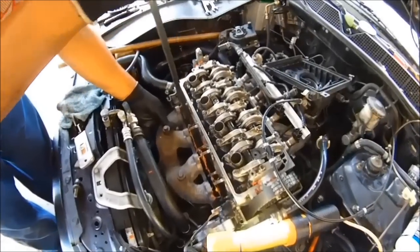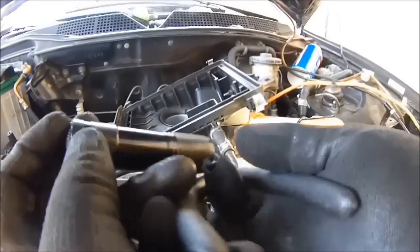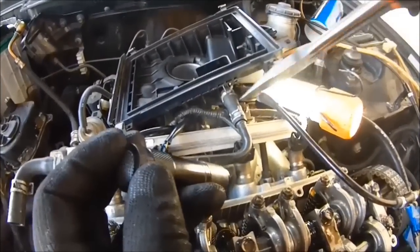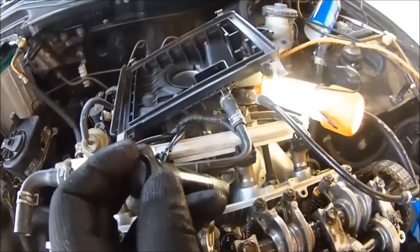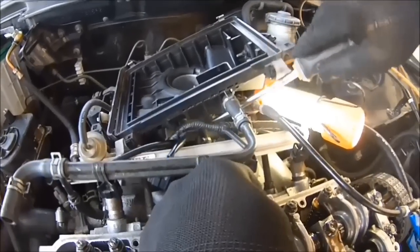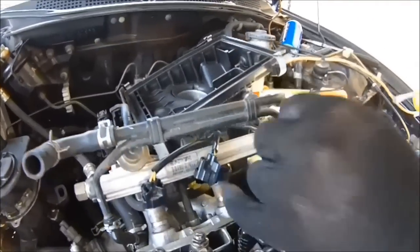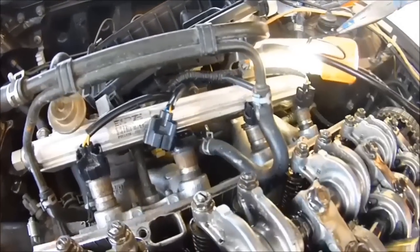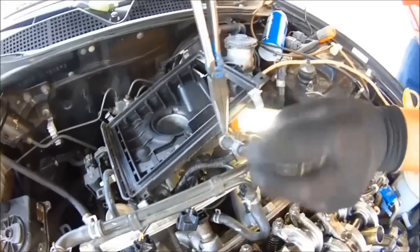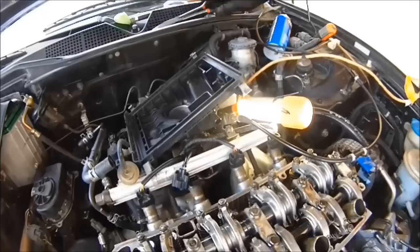It's going to be a little hard but it's working. Next, take off this hose here — take off the clamp, then push it back and work it out. Get this out of the way and work the other clamp. Now take this off from the air housing, move it to the side. The reason you're taking that off is so we can now work the bolt behind it.